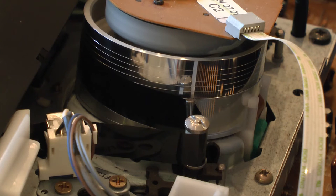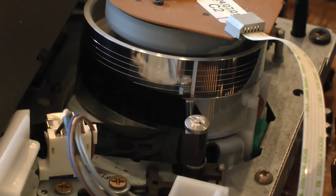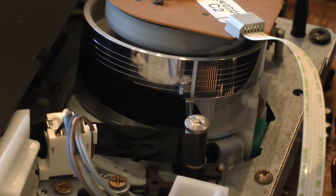Damp tapes, or tapes that have gotten fungus on them — any sort of white on the tape itself, or if you can see white inside the window — best just to get rid of that tape, or use it in a machine where you're not too concerned. Because the oxidization of the tape can cause problems in so far as the tape can de-stick itself, sticking onto the video head and degrading it. In most cases that can be wiped off with a bit of isopropyl alcohol, so generally it's not too much of a problem.